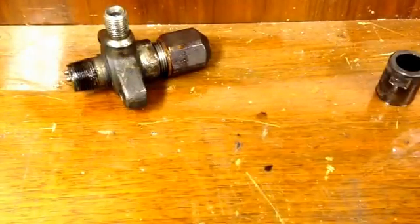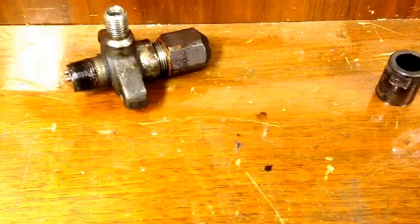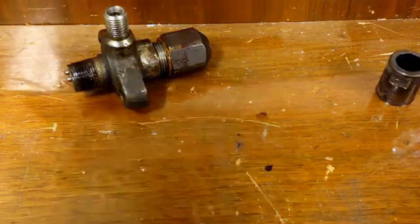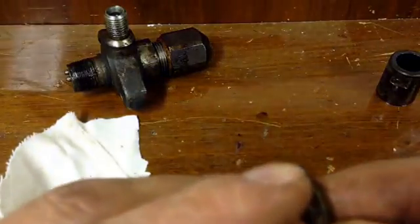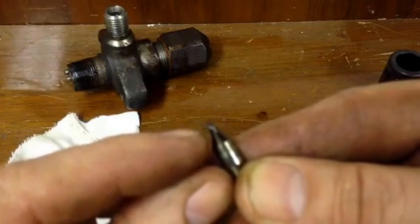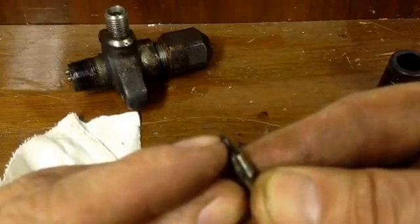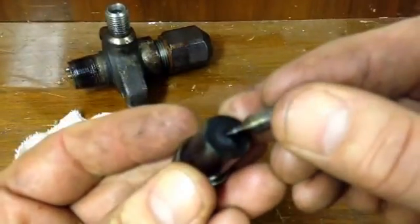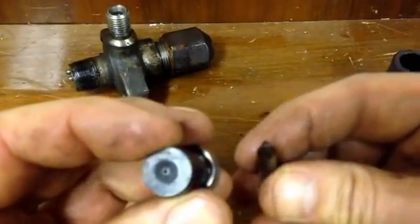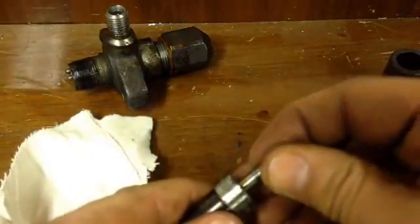Other things that will work: the polish you use for cars, or just general car polish, will do it, as will jeweller's paste. I would say you're going a bit far if you're using cutting paste, but I have done it. You also want to look at the end of the pintle — the very tip is just a guide. It's stepped: big step, medium step, an angled bit, a flat bit, an angled bit, then there's the bit that seals, and then a little guide on the end. The guide sticks out but it's not the sealing piece — the tiny bit at the end just guides it back in the right place.